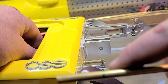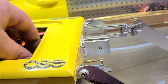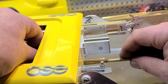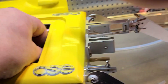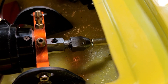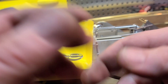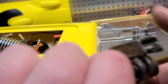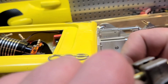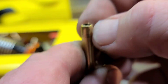I stuck this end into my strut so I know how deep the stuffing tube goes in. I'm holding it in place to make sure it'll be the right length — looks like it's going to be perfect. You don't want a big gap at the collet; you want it basically a couple millimeters from the collet when it's fully unscrewed, so you don't kink or roll your flex cable.